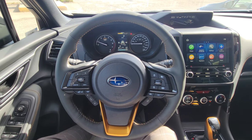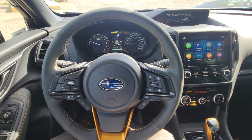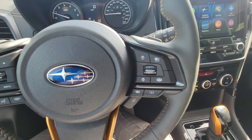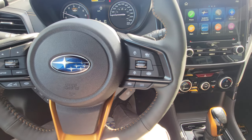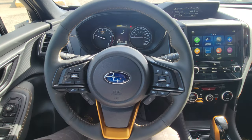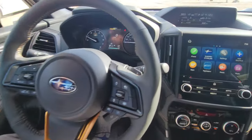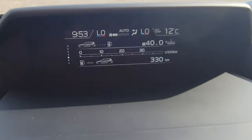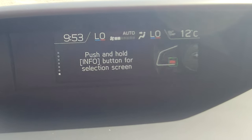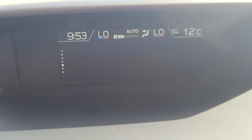When lane centering is on, there are gray lines that illuminate on either side of the follow distance indicator. The EyeSight cameras — those two boxes — can see road lines; whichever side it can see will illuminate white and give you gentle steering input to keep you in the middle of your lane. It's a great driving aid for the second half of a long day of driving. I only recommend it on the highway or freeway. This is not hands-free — not a Tesla, not self-driving.